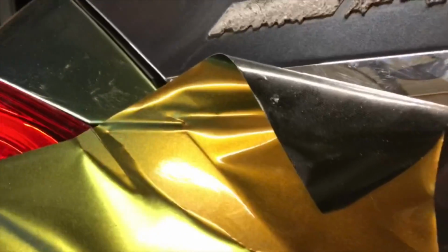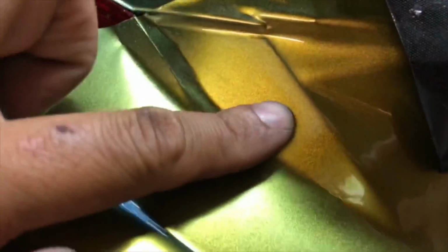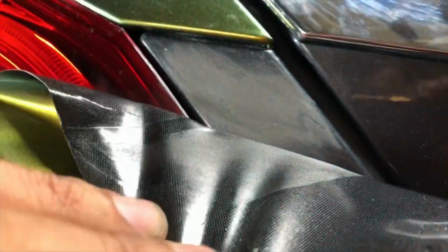Here you go. So now it's been sanded lightly, very lightly. I've been instructed to do so by the owner, and I have text messages to prove it. But here, basically, here's the difference. So it's a very light difference that you can't really see. I'll give it a little more of a graze, but as long as you don't hit the paint layer, you can re-clear this, so that's fine.